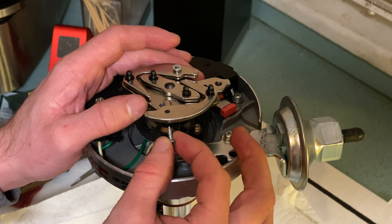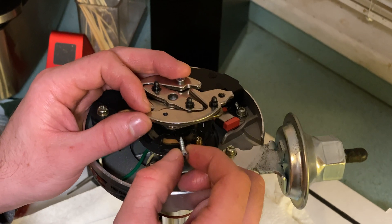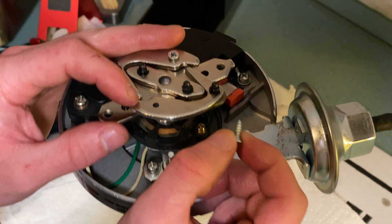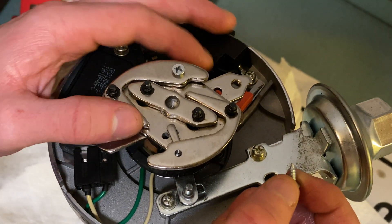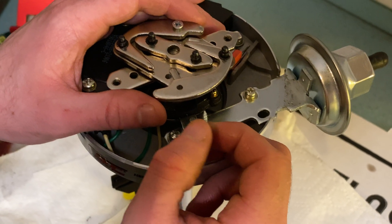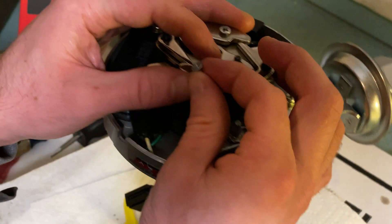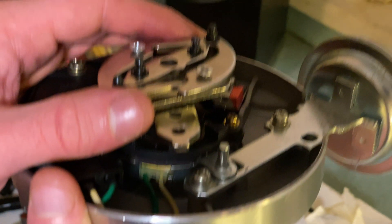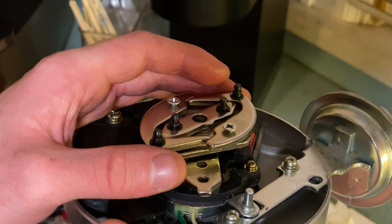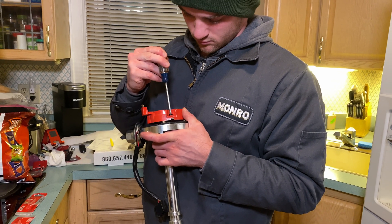It turns out that the machine screw method in the instructions didn't work for us. So we ended up going to Home Depot and picking up a couple of sheet metal screws, maybe three-quarter inch long or so. Matt drilled the bottom hole the same size as the top hole because the bottom hole was just way too small for anything to fit in. With the sheet metal screw, we put one in one side and it went perfect. Now he's putting the second screw in the second side. They're on and they stick up a little bit because they're a tapered head, but it shouldn't be a problem. The rotor fits — we have success.